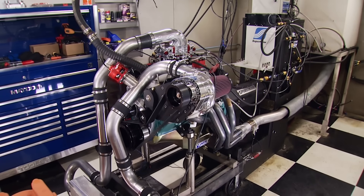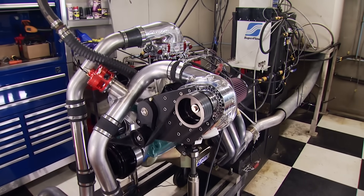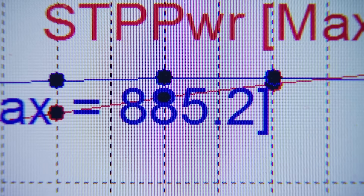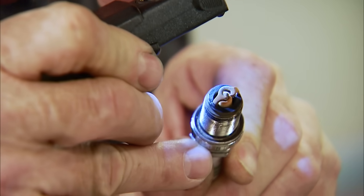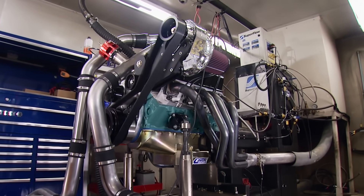35 to 55 at 600 — let's see what it does. Oh my God: 919 horsepower, 885 pound-feet of torque with 28 degrees of timing in it. At this point, we'll increase the tension on the belt and check the plugs for any sign of damage. No craziness — we'll leave the timing right there for now and increase the sweep from 4,000 to 6,500 RPM.